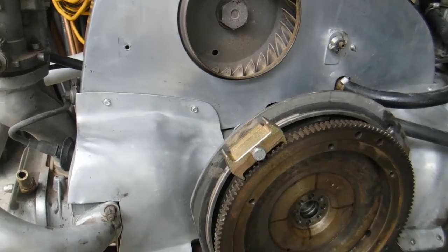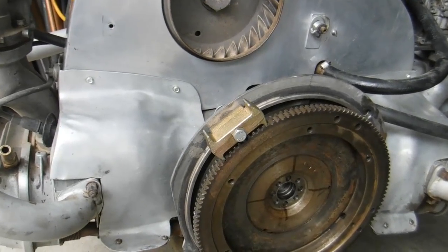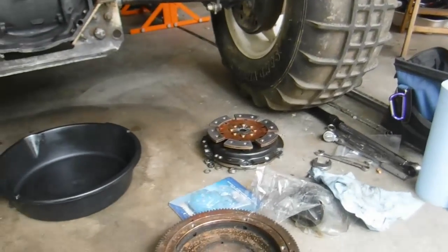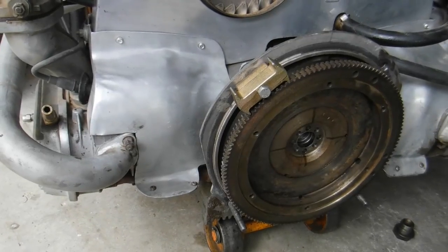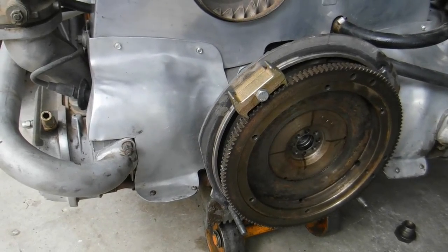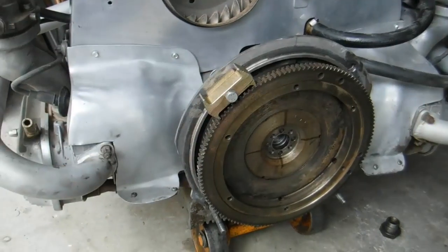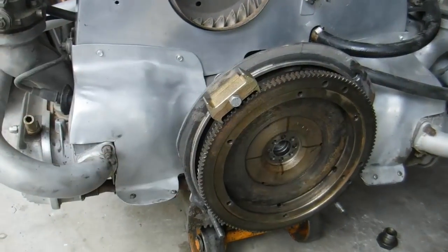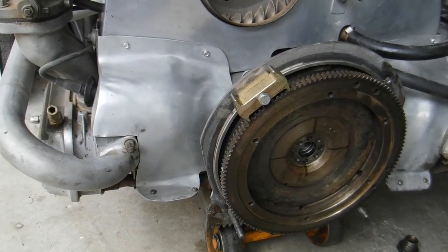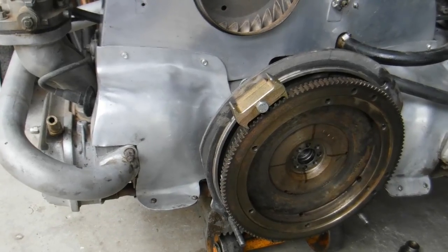Hopefully with the new seal that will take care of an oil leak for a while. When you're out in the sand dunes, sand gets into everything and it is kind of hard on that particular seal. The old clutch wasn't that grabby, and it might even be smoother yet with the stock flywheel on it. The only reason guys go with these lightened flywheels is because these aftermarket cranks are usually counterweighted. So basically you're just moving the weight from the end of the crankshaft and spreading it out through the full length of the crankshaft. It makes for a smoother setup — it's easier to balance, it costs more to do, and that's why the factory didn't do it.